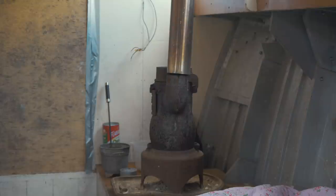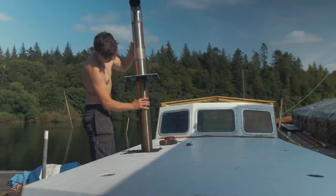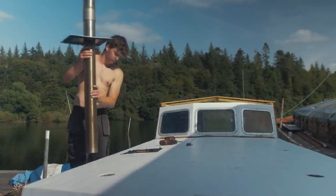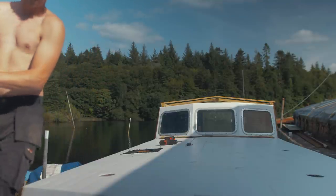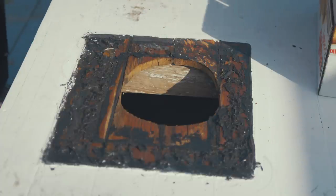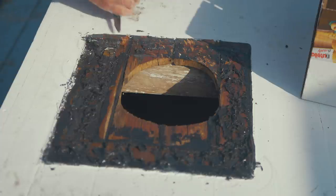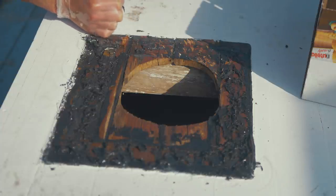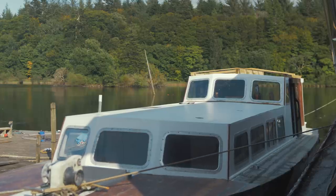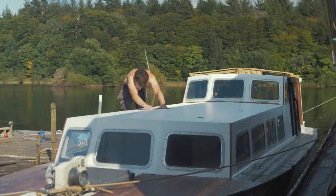Once the screws were removed, it was just the butyl rubber and the Sikaflex. I added a bit of Sikaflex extra as an extra bit of security, like a gasket, to prevent any water leaching in there. And it's really incredible how strong this was. I was using a lot of my force to get this off the roof. So it just goes to show you, you probably don't even need the Sikaflex. The butyl rubber is strong in itself, but it's good to have it for extra security.